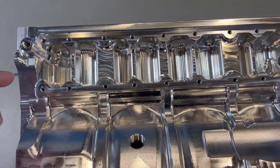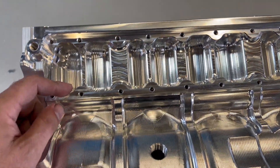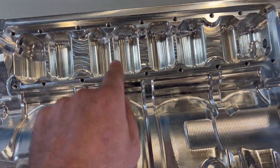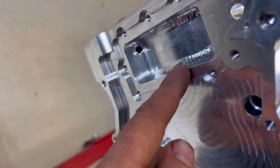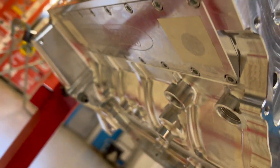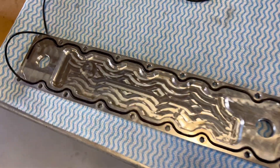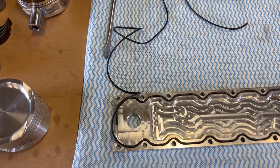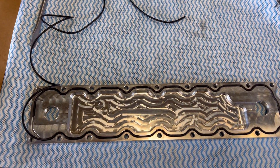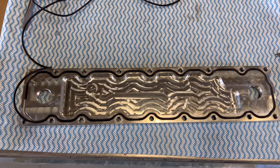So the block we've gone for is what's known as a dry deck. It still has water around all the cylinders, which is through here. Water travels through here, around the front, and behind another plate here, and then travels around through that plate as well. These plates screw on and come with O-rings. The O-ring just comes as a big long length and you just cut it down and glue the two ends together. I'm also going to put a bit of three bond on it to make sure they don't ever leak.